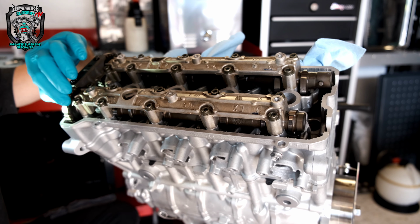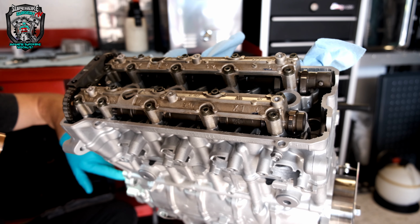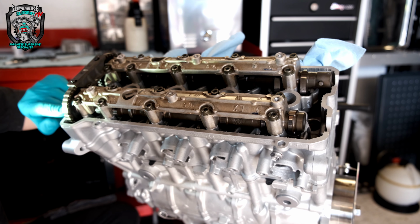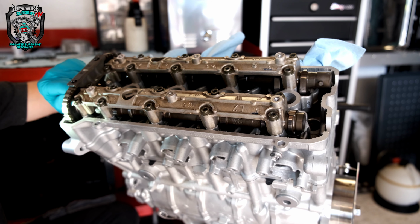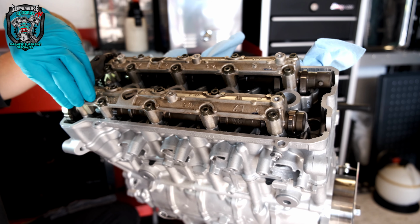I think you might have seen, I just use a little Velcro strap, but you can use a cable tie. Once you know you've got the exhaust cam in the right place, you cable tie. It's not always possible because the sprockets are sometimes solid, so you can't get a cable tie around it.